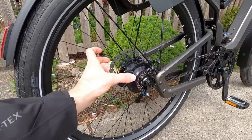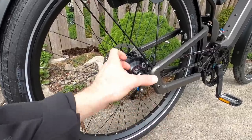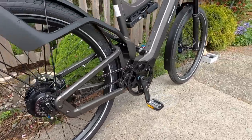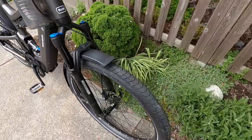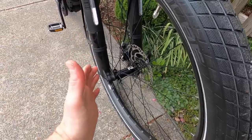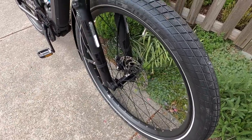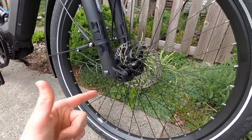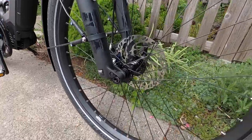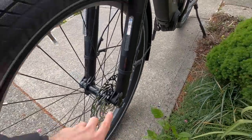I measure about 135mm hub spacing in the rear with a 9mm axle — it's an actual axle connected to the Roloff, not a skewer. Up front there's boost hub spacing, meaning it's a little wider at 110mm instead of 100mm, giving you a sturdier bracing angle with the spokes. There's a 15mm quick release skewer through the front. Fox does a great job — you can dial the lever position so it points up and won't get snagged.